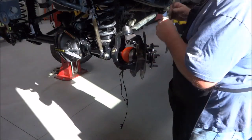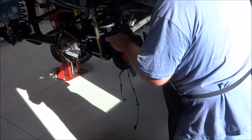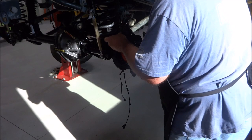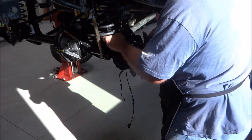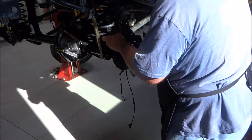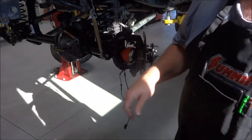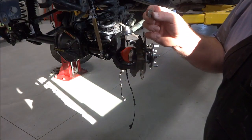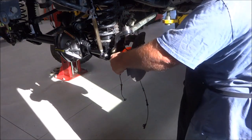Okay, all the way to the lock there, and I'll line it up right along the outside of my axle tube, right there, with the inner tube, and I am right on 37. On the money with one 3/8 washer under the head of that. So that's where I'm going to leave it. I'm at 37 degrees steering angle. I can live with that.